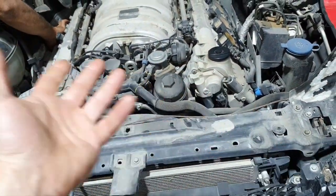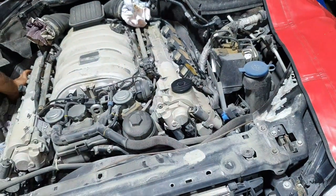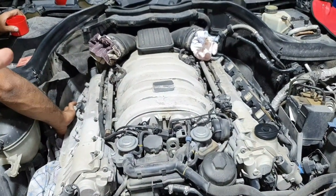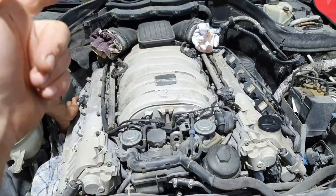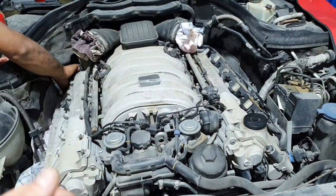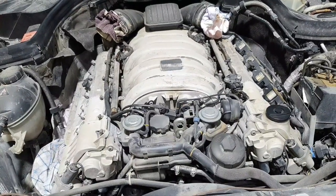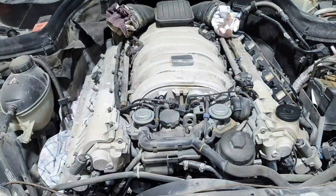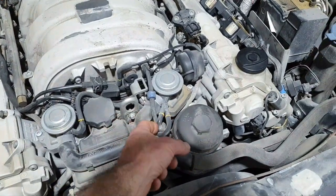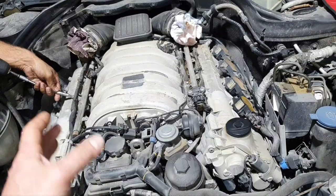Alright, stabilizer bar links front, engine mounts optional, exhaust manifold gaskets without silicone, to put fresh ones and also the stud that's missing, to repair the exhaust from the header to the end. Axle boot back, inner and outer, one time. Rear differential with a question mark, I don't know if the owner changed it recently. Transmission oil filter and seal because it has a leak, oil pan reseal, and replace the drain plug. Then, this is now out of memory, most of the things I'm saying. Intake manifold, like I said, fine. The secondary injection doesn't need to be replaced because you can block the line and deactivate it completely from the computer. It does have catalytic converters, so it doesn't make any sense. Air filters, AC filter.